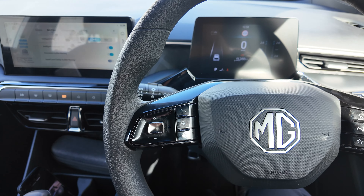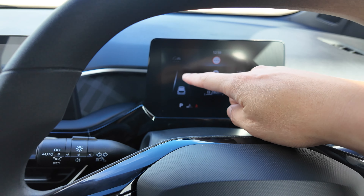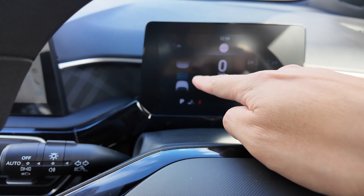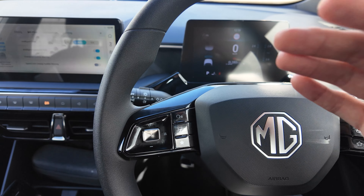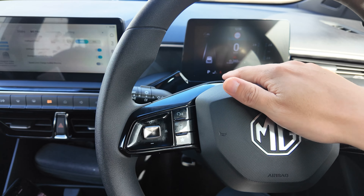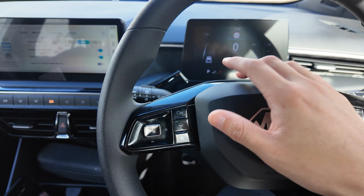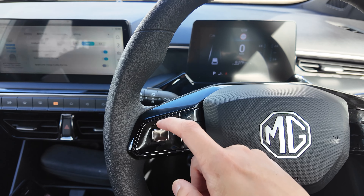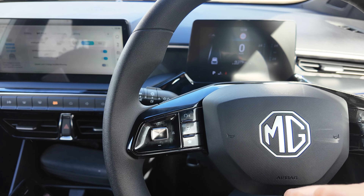Next function is called ACC — Adaptive Cruise Control. When you start driving the vehicle, you can press this button to set it at your current driving speed. The lowest set speed will be 30 if you're traveling less than 30. The vehicle will travel at your current set speed if the road is clear. When the road is not clear, the vehicle will see the car in front and keep a safe distance. To change that distance, go left and right — you'll see the bars change: 3, 2, or 1, whatever you like.